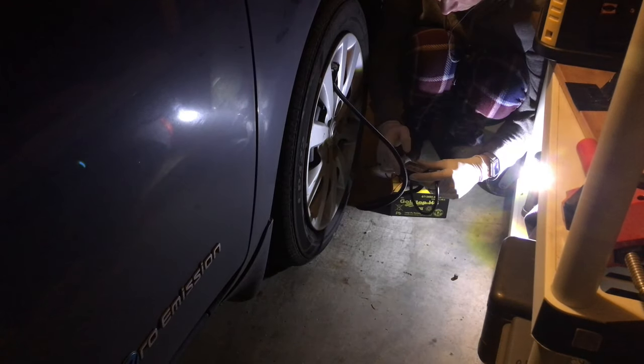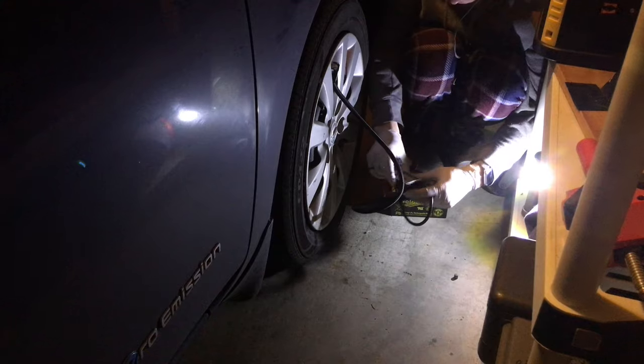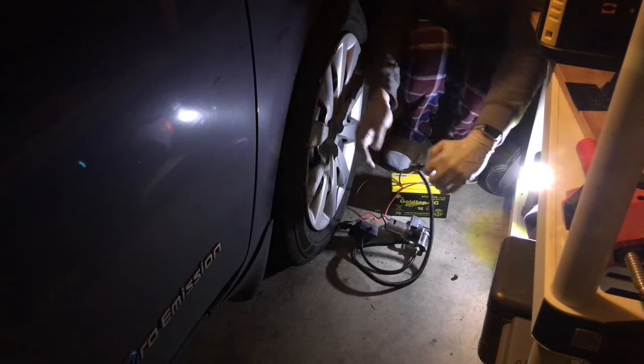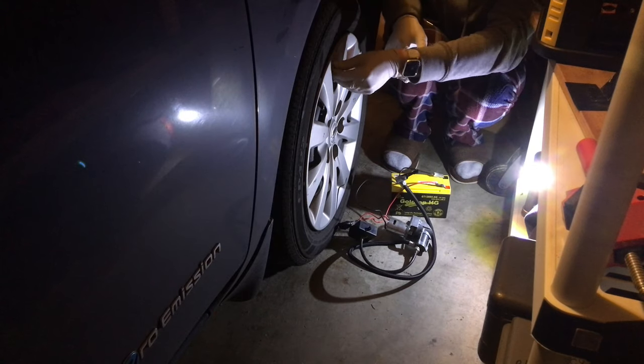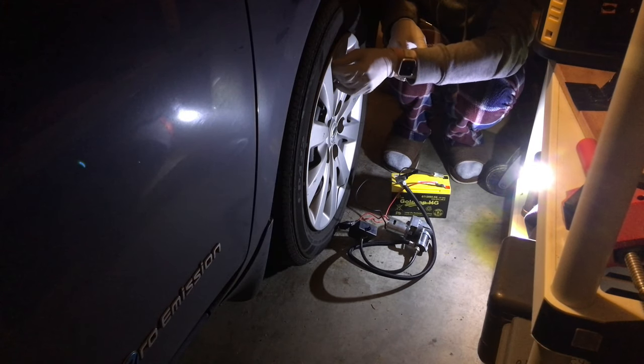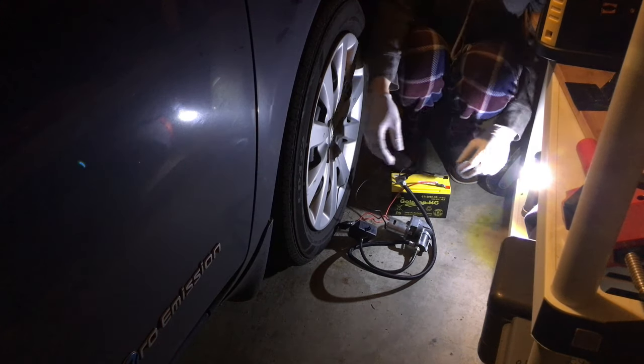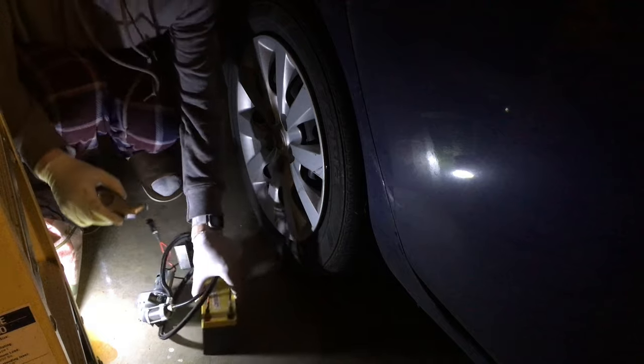I use the gauge on the unit and a light to monitor the gauge. This system is an improvised system. It works great — I've been using it for years. I'm aiming for between 37.5 and 38.5 PSI in all these tires.